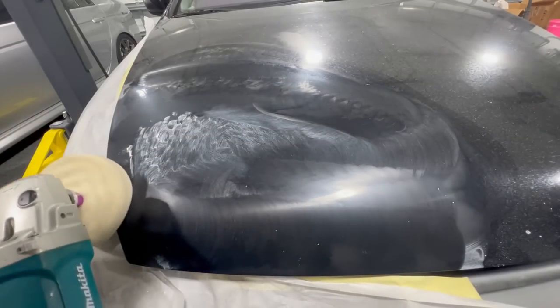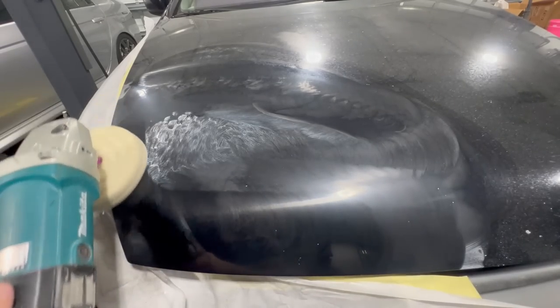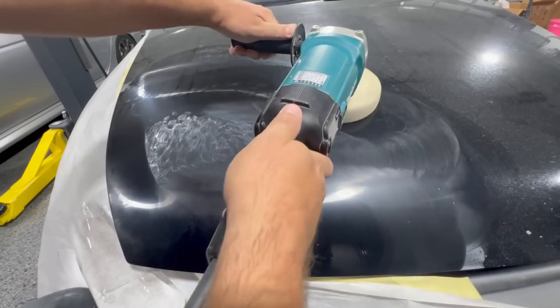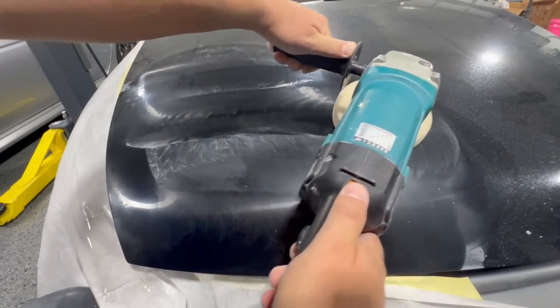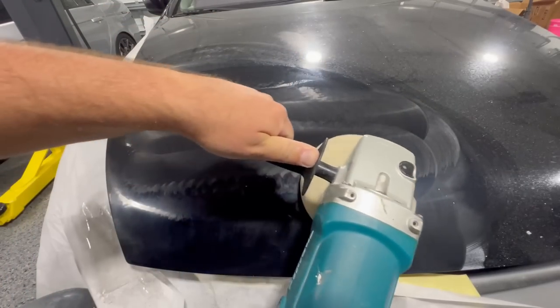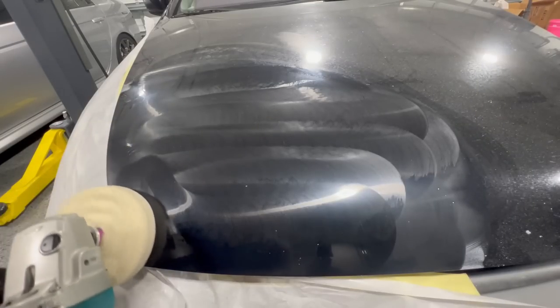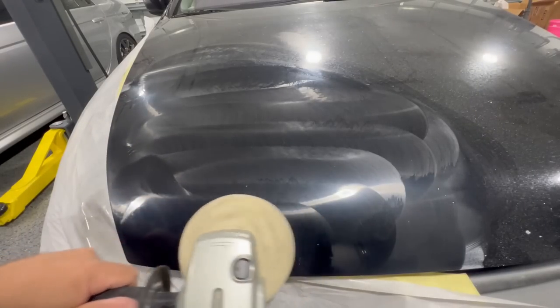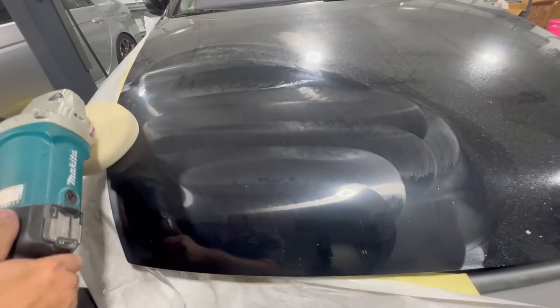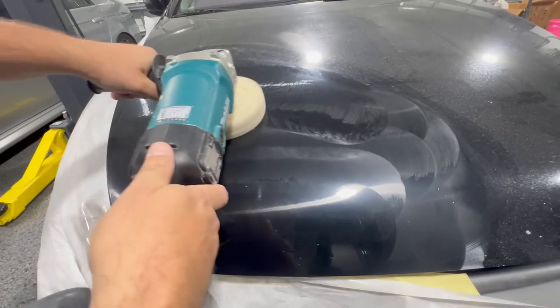And once again, I'll leave everything in the description. I'll give you some different options that you can use to get the job done. There's a few different products that will get the same result. It might be a little bit more cost effective for you. The one thing you're gonna need, you cannot do this by hand, is some sort of rotary polisher. A regular polisher is not gonna have enough RPM to really get that shine back. The rotary is.